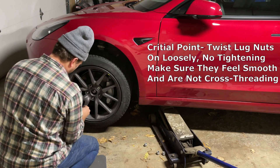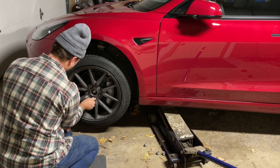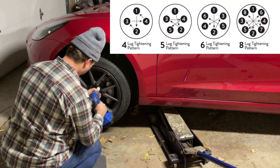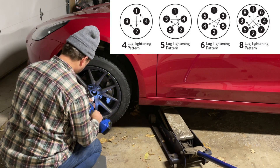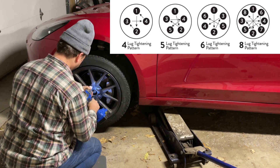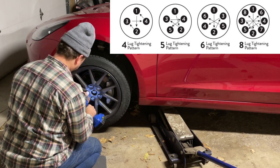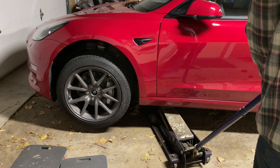The order in which you loosely put these on doesn't matter. It's extremely important when you actually tighten the lug nuts later, but you can practice your tightening pattern with the hand tightening if you'd like. Next, tighten the nuts with your impact wrench or wrench — get these tight, but not too tight yet. It doesn't matter where you start, but the order you go in after that is critical. In general, the next nut to be tightened should be across from the last one, as far as possible. You can also see diagrams online like this one and follow those patterns.